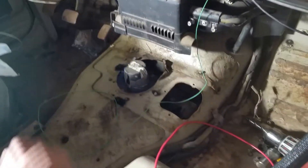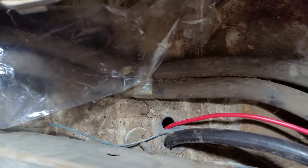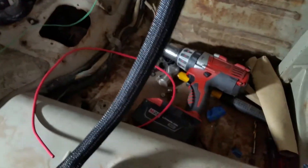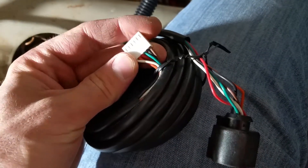Put that wire under the car somewhere. There's a hole right here but it's only like 3/8ths — in the bottom of these there's a little grommet with two 3/8ths holes. Going to run the fuel pump wire down there and I was thinking about maybe boring it out a little bit bigger to fit this plug through. It'll go up to the wideband sensor.